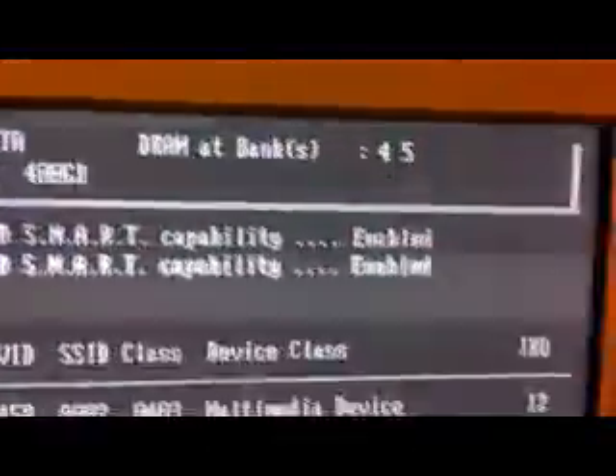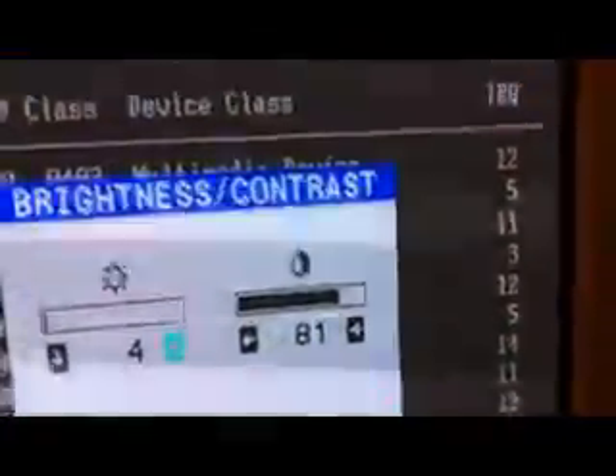Trinitron monitor, IBM version. There's a lot of these were made around 2000, 2001 and they've all got the same little drama. You can't turn the brightness down, but it's excessively bright. And sometimes you can actually push it far enough, you can sometimes get retraced. What this does is it makes it not black, which means it looks like shit.